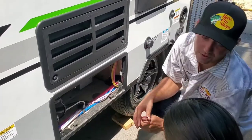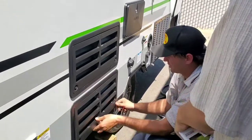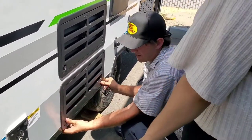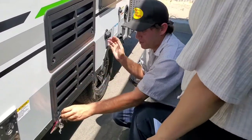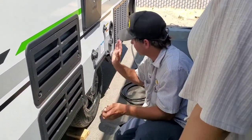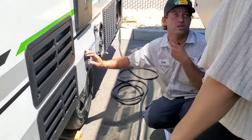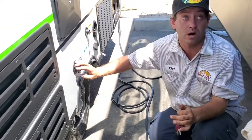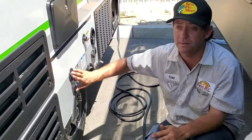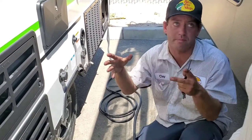It depends on what you're using inside the trailer. That's the only thing, because remember, you're gonna get the water inside the unit. So depending on the camping you're gonna be doing is how you're gonna put water in this trailer. So either you're gonna be at full hookups, you're gonna go to city, okay? City water is when you have constant pressure coming into the trailer and you need to make sure you're using a water pressure regulator or regulating the water coming into this, okay? Because if not, you're gonna have constant pressure and eventually it's gonna blow the PEX lines.